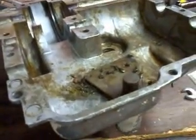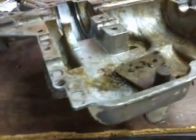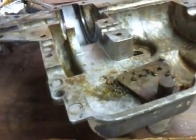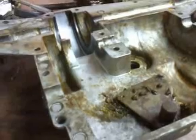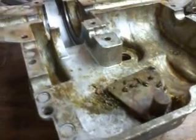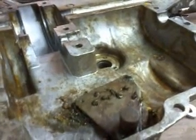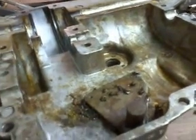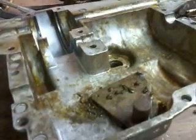Not to mention they had 8 or 9 new old stock of bentonite grease, which, by the way, was made by Tecumseh, a.k.a. Peerless, their transaxle transmission line, which is no longer around. So, I don't know who is currently making bentonite grease or if anyone is making that grease. So, if you come across it and you've got more than one lawn tractor with a grease transaxle, buy at least 2 tubes. They're 32-ounce tubes. 1 tube should be enough for 1 transaxle. Even if you only have one tractor, if you plan on keeping it for another 10, 20 years, buy yourself another tube, because in about 10 years or so, you're going to want to change out that grease.